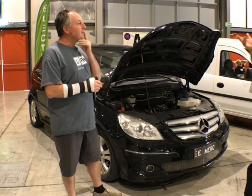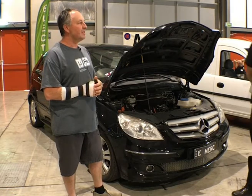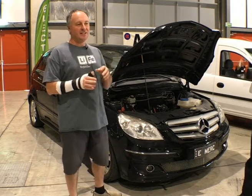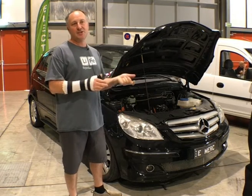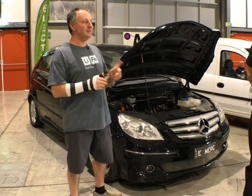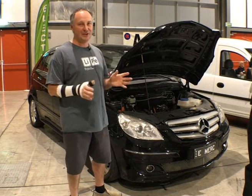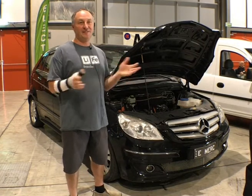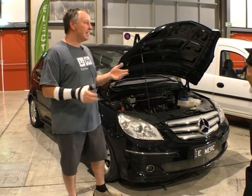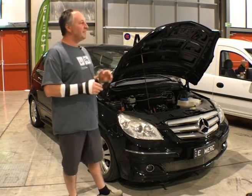There were some switches to do with charging such that when you open the port it enables the charging. On the charge door we had a switch with a normally open, normally closed position. If the charge door was open it would let you charge, but you had to actually close the door properly, and then it would let you drive the car. If the door wasn't closed, you can't go anywhere — so it stops you driving off with the lead still plugged in. A lot of regular cars refuse to drive off if you've got the charger plugged in, and you've done this implicitly here.